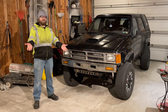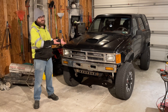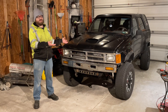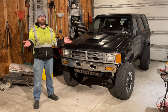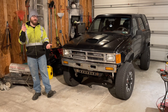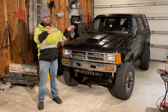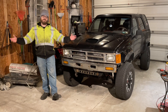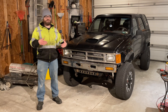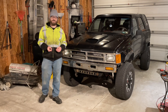I'm happy to prove that I built this supercharger manifold and a whole kit and it's working — that's pretty cool. Most people buy M90 superchargers, say they're going to do something, and never do it. I did it. It's done. It's supercharged. A lot of people said cylinders 1, 2, 3, and 4 would be rich or lean because of the manifold design — all those people are wrong. I looked at the spark plugs, which is how I tune this thing, and they're consistent front to back. No major variations.